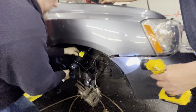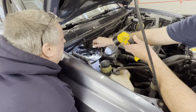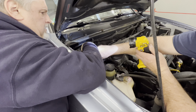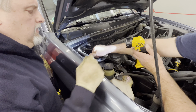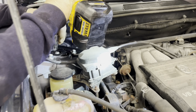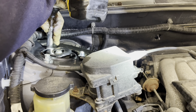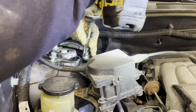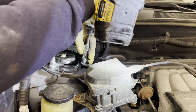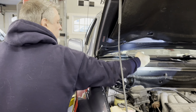We're going to feed this thing up the same way we took it off. So we've got our 15mm on here — I'm just going to run these down evenly and it'll start sucking up. We're going to go back and put a half-inch ratchet on to make sure they're all tight. Alright, let's get the strut back in place now.